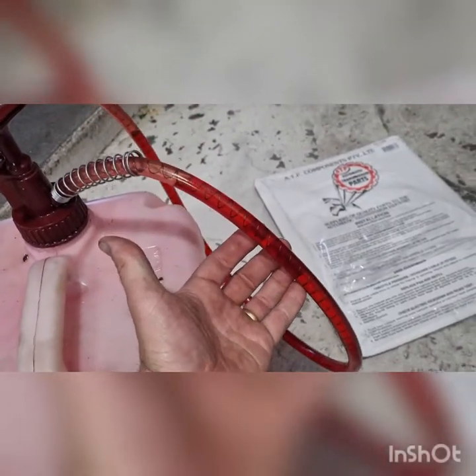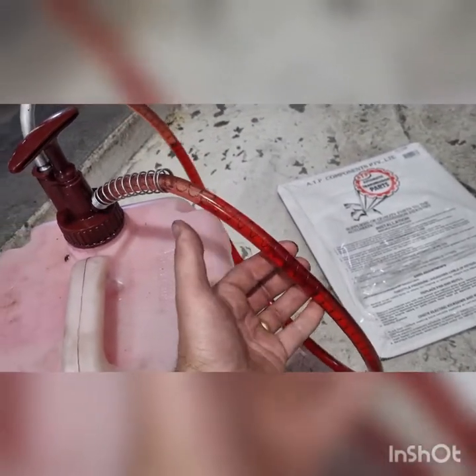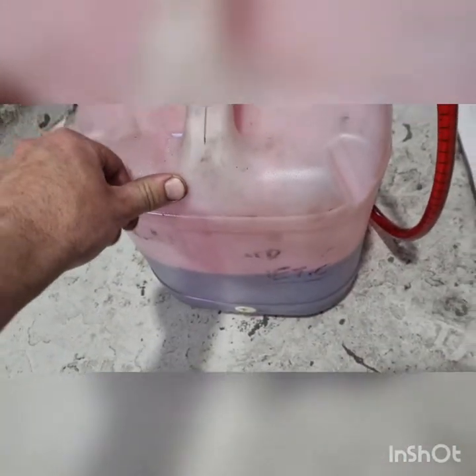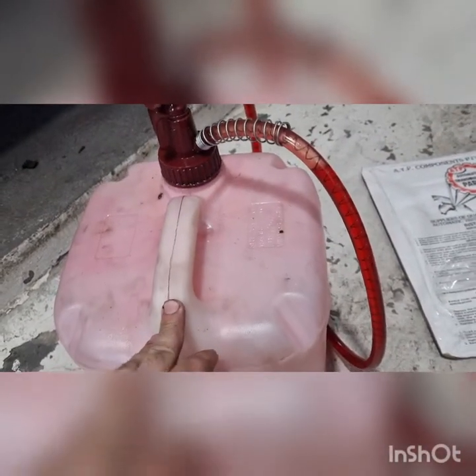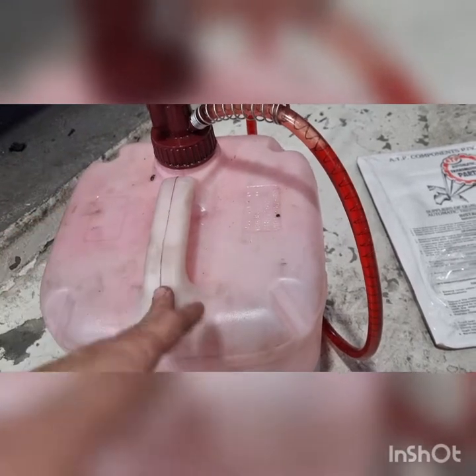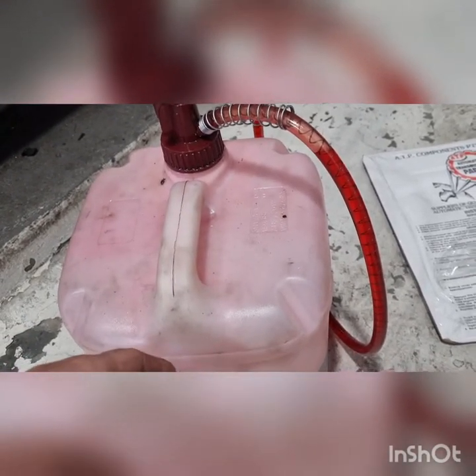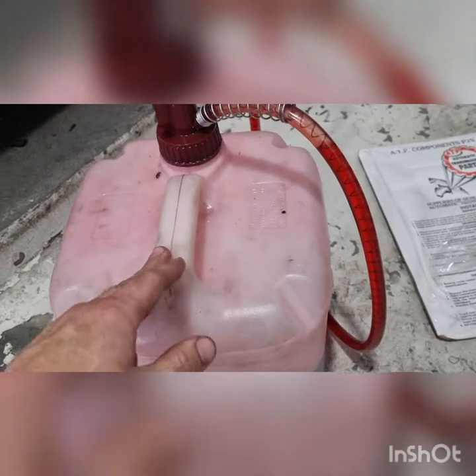This is our oil. You can see the condition of the oil here, nice and red, and before, we had that dark brown colour from being burnt and some gear slippage, standard stuff. But yeah, this is called a Lube Guard. It's fully synthetic. It does Dexron 6 oil. It does another multiple range of oils. And that's what we're going to be putting in.